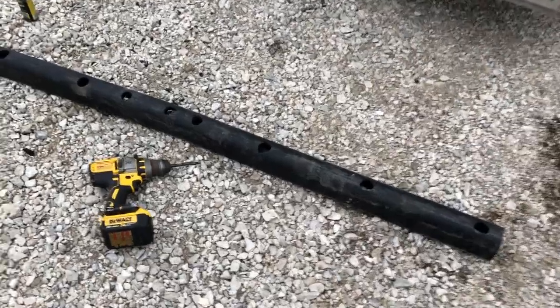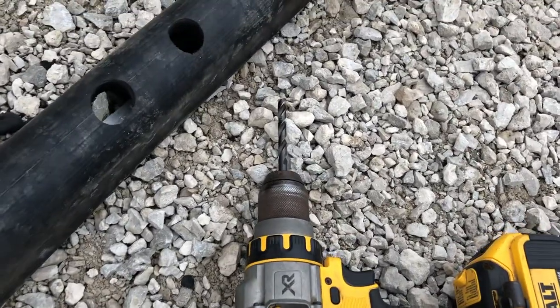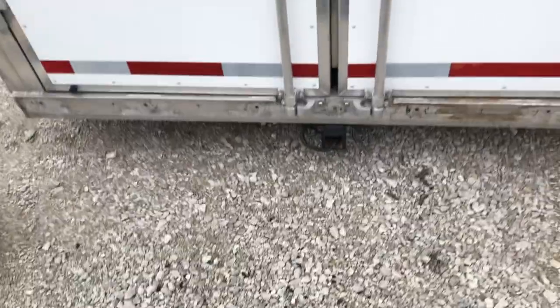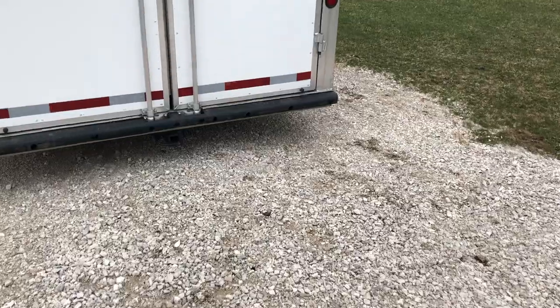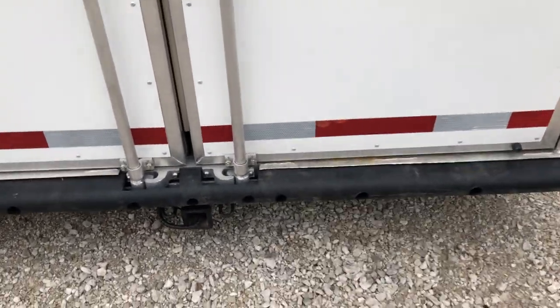It's the next morning, just got off work - a little tired if you can't tell. It's supposed to rain later on so I'm gonna get right into this and try to get it knocked out today. I got that piece of aluminum down in there, got all the holes drilled through it. Got my 5/16ths - those are 3/8ths bolts - and on those marks there I'm gonna drill and tap new holes in this and hopefully it all lines up right. Got our first one in there, supported down there through, and drilled and tapped the rest of them. Just like that, got it installed - I do gotta go back and trim out where that latch comes out.